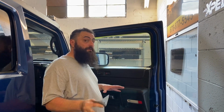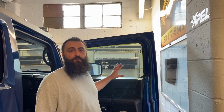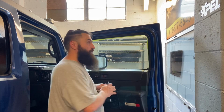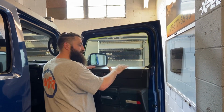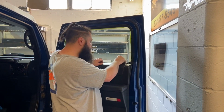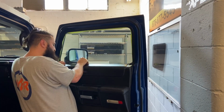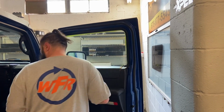Okay. Now I like the bottom load, and I normally don't pull anything on panels or nothing like that. On this one, it's pretty easy to pull the sill on this. And this one's a little bit harder than some windows, so I'll just go ahead and make my insurance policy. I'm gonna pull the sill out. I've already taped all of the felt, because that's all felt. Now to get this sill out, you're just gonna pull the top back and should pop. Those are those long plastic clips. And that's it, so that's pulled.